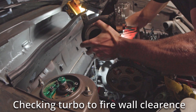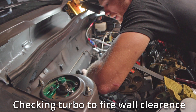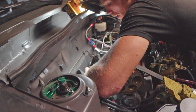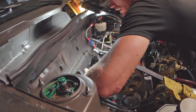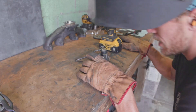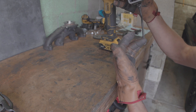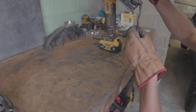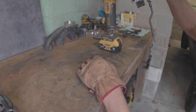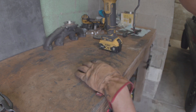Here we are dry fitting. I already have the clamp on it so I'm accounting for that distance, and it looks like it's going to go. The one tricky thing I'm finding is this is the orientation I'm going to need this baby in, and that is not at all how it was designed to operate. So I might have to get creative with how that solenoid is mounted on this turbo. Right here it should be fully extended in the way it normally sits, and this should be fully closed. Now because I clocked it, it sits differently — I'm just going to cut this off and weld it on about 90 degrees different. That way when it's sitting like that, it'll be coming off this side and have lots of throw.